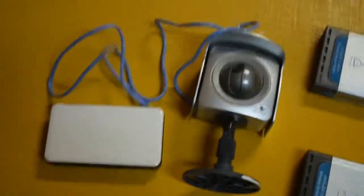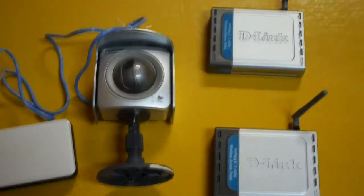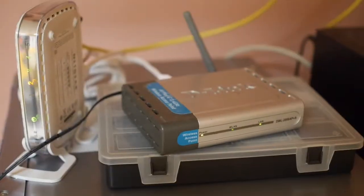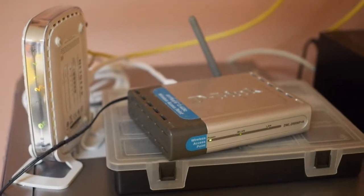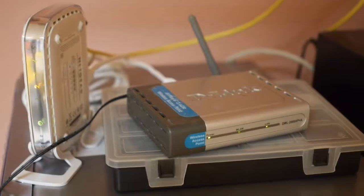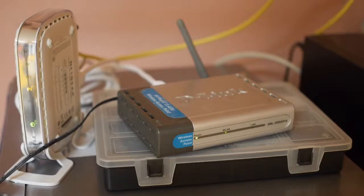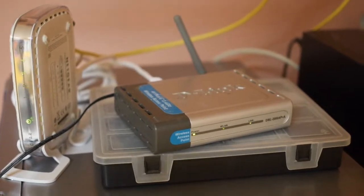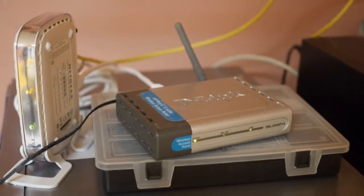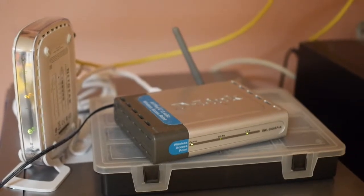So what they do is act as a wireless replacement for the Ethernet LAN. Here you can see I have a hub, and one of them will connect to the router or the switch that's on the existing network. I connected this D-Link access point to the network switch which is connected to the router in another location. This is going to act as the repeater of the network signal, transmitting it to the other D-Link bridge point. And this is already set up through the software — in this model it's actually called WDS.